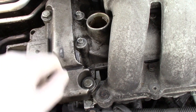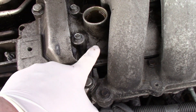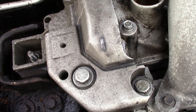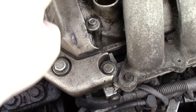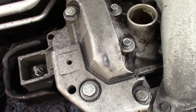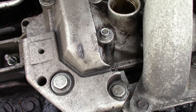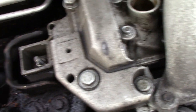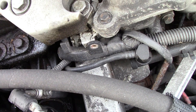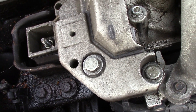So I think it's got to be deeper in there somewhere. If it had been the seal between the cam cover and the top of the cylinder head, why would the oil have gone up here? It just doesn't make any sense. My best guess is I need to remove this — it's just a housing, just the engine mount plate. I think there's got to be something below that throwing the oil out. I think we're going to find oil on the cam belt or something, and it's been thrown at high velocity about. It's the only way I can think that it was getting dispersed all around here.